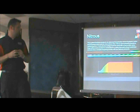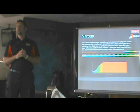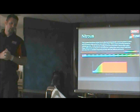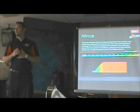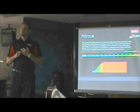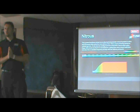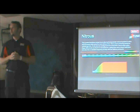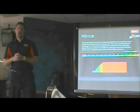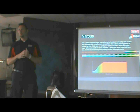All right. Nitrous. We've spent a lot of time on nitrous because of Cecil, of course. I've come up with a pretty interesting strategy. Before I go on with this, I will say that if you go to a kit like this, you're not left out. If you have aftermarket boost controllers or shift controllers or nitrous controllers, those things can still be used. They actually have a really cool advantage of being able to mount that thing on your bike and make changes to it any place up on the starting line if the track's not as good as you thought it was. So those things don't have to be taken off. The ECU can accommodate the AV output signal from a nitrous controller and respond with fuel and ignition that way.